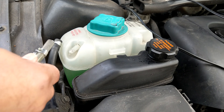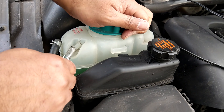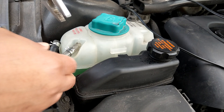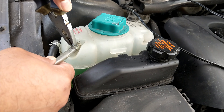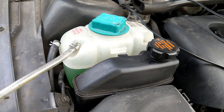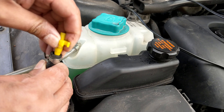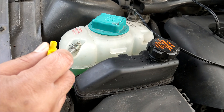You might also want to repeatedly flush out old coolant — maybe it's the wrong specification or it's gone a bit murky. This is another great way of doing it. It doesn't replace gravity draining of a cooling system, because you can get sediment that hovers at the bottom, but if you've got no alternative or just need to do that bit of maintenance, this might prove useful.